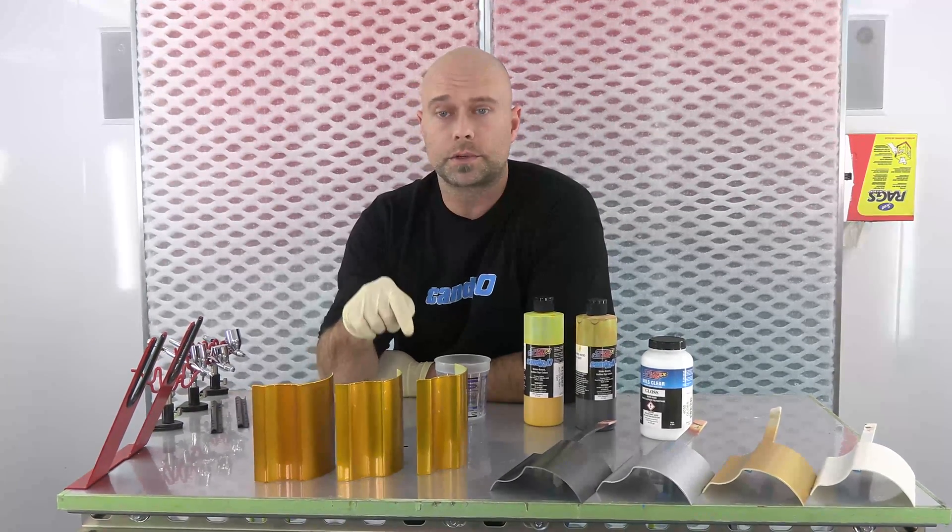We're in between coats with a little dry time, so let's take this opportunity to show you exactly what I was talking about. These are the three samples that were my test panels — we always talk about doing test panels to figure out what the color is going to look like and what the concentration should be. These are all over 6013 silver sealer. This was my two to one ratio — a very strong mix of tequila yellow and lemon candy. This is my three to one mixture, a little bit lighter, and this is the one we're spraying right now that I think matches that Pagan Gold color pretty darn close. This is the four to one mixture — just a little less concentrate and a little more lemon yellow. I really didn't see a massive difference in the final color, which is kind of why I opted for the three to one. Otherwise we start washing out the color. This shows the importance of doing a test panel.